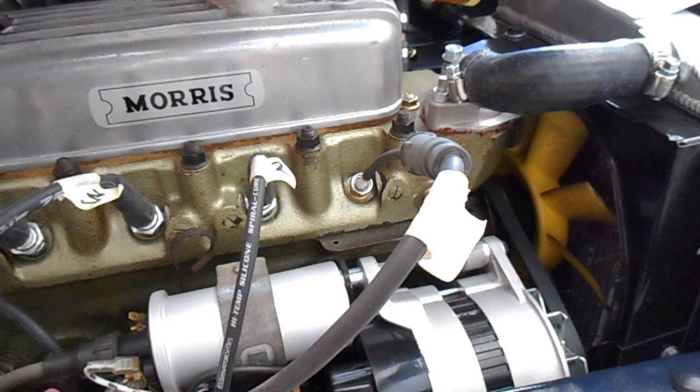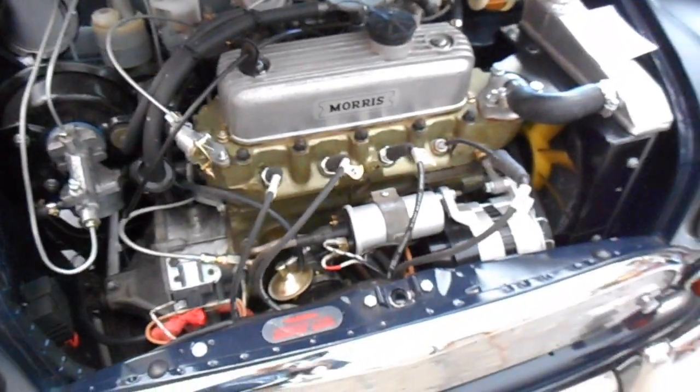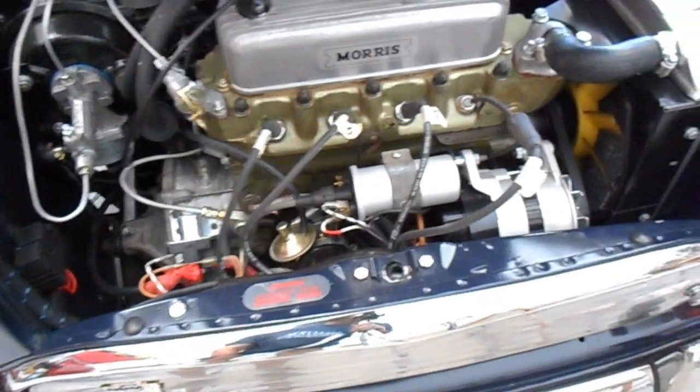On the left-hand side, I needed to adjust it a bit to get a blue flame the same as the right side. It was only about half a turn to make it a little bit leaner, because it was burning a bit rich. I'll let that cool for a minute and then undo everything. Hopefully you were actually able to see the colour of the flame. Thanks for watching.